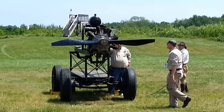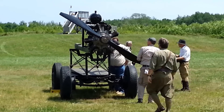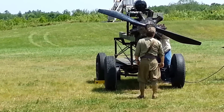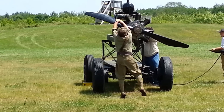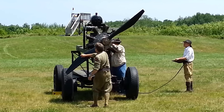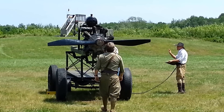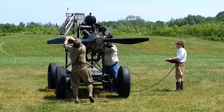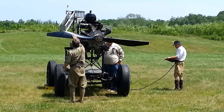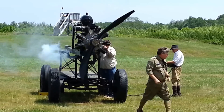There's a little pop. That white smoke — nothing to worry about, ladies and gentlemen. That's the castor oil being pumped through this engine to keep things lubricated. It is exhausted right out through the ends of the cylinder heads through that exhaust valve with the exhaust smoke and spent fuel. It's being blown all over the airplane, blown all over the pilot. If you take a look at our Sopwith Pup after we've flown it — that Pup is powered by an 80-horse Le Rhône rotary engine — the plane is completely covered in this sticky film. The pilot is subjected to that as well. It's in large part because of this fact that pilots from World War One wore what they wore. There are a couple of pieces of uniform that almost everyone recognizes belong to World War One.